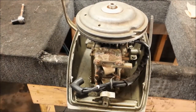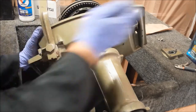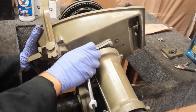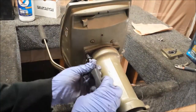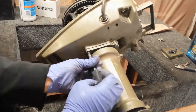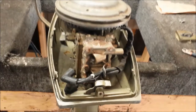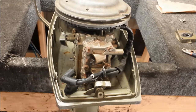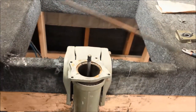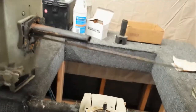Now it's just the powerhead mounting bolts. I'm going to take off these bolts first — shouldn't be too bad, the right angle should come right out of there. With those four bolts out, you should be able to remove the entire lower pan. The exhaust tube and water pickup came with it, as it should have.